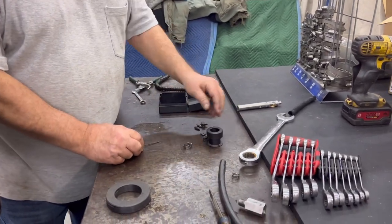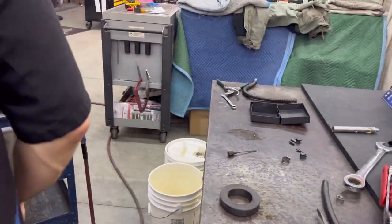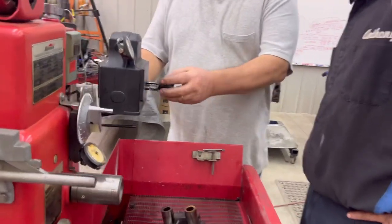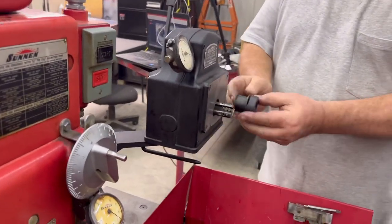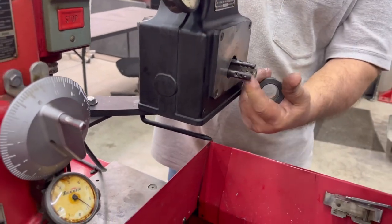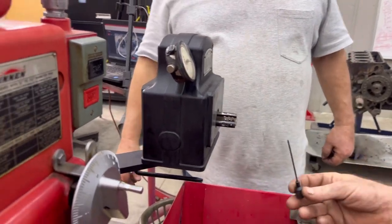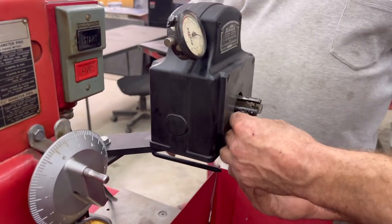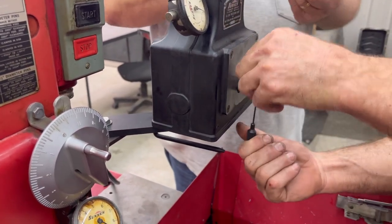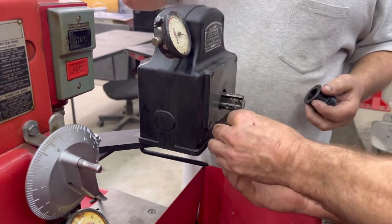The slot is designed so you can put a wrench and make adjustments. Okay. The small set there. I'm sorry, this one does just these points here. So what you're going to do is bring these points back in, put that piece on there, and you see where the slot is? It's right on it, yeah. And grab that wrench, and you'll feel there's a little set screw under it. That little guy? Yep. You see how you're turning it? What you're doing is you're bringing it into the center of the bore by adjusting that. Take it back to where it was, kind of.